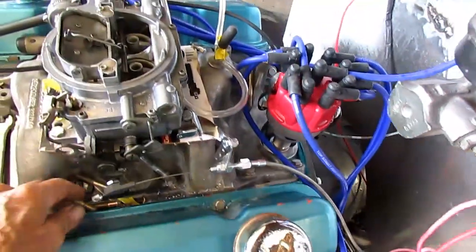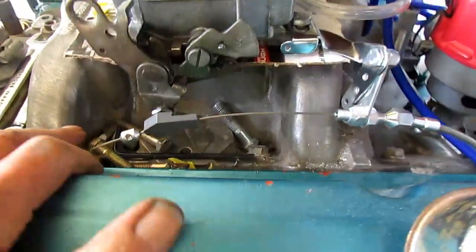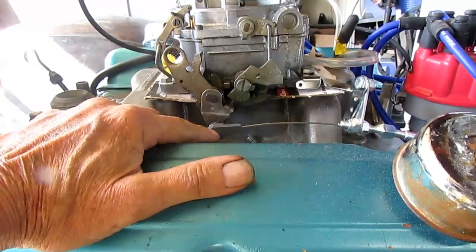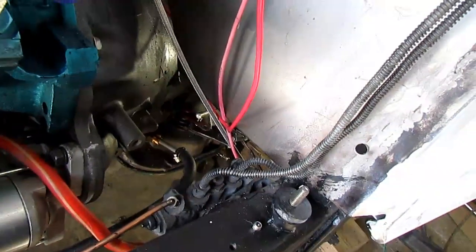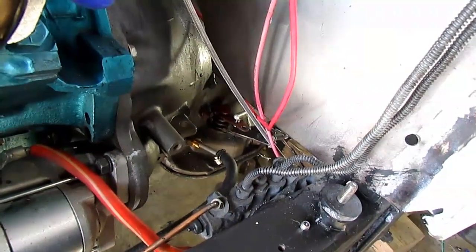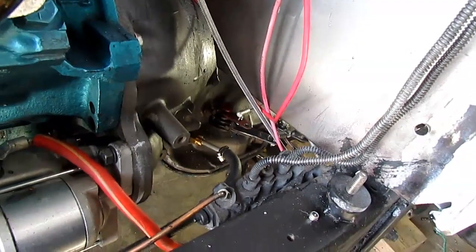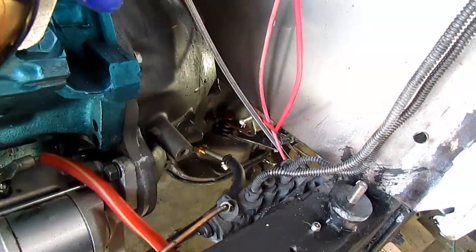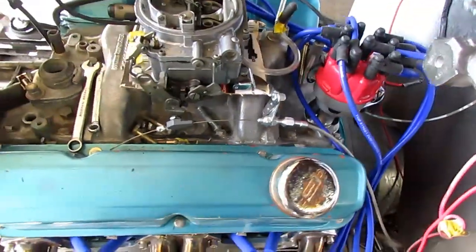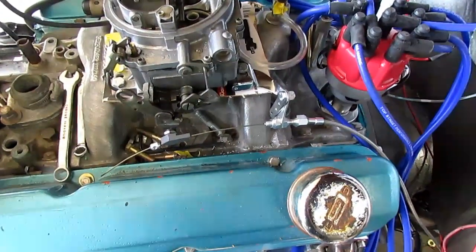Anyway, that's my recommendation for a 727 kickdown. Once again, the most critical part is this distance here — the radius of your carburetor. The kickdown shaft pivot point down there should be exactly the same length. I've got mine a little long so it's probably going to be a little slow, but my lever had a step bent into it and that's as close as I can get. I think it'll be plenty good enough. Like and subscribe if you want to deal with missing bell cranks — this cable method is a good way to do it.